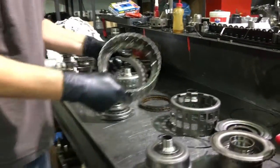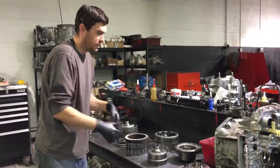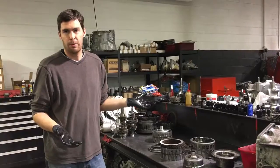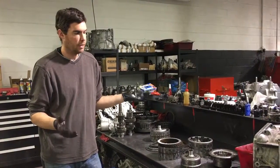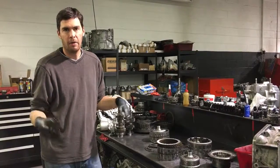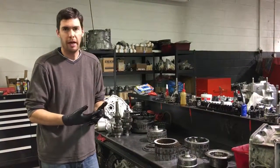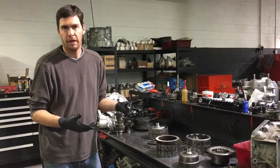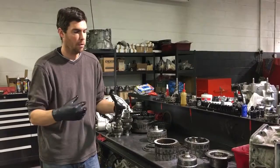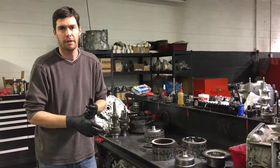So that's about it. There's the carrier — you see it's divided in the middle. That's a very basic explanation as to how this clutch system works. Basically all the clutch is doing is transferring the engine power to the gear set in a smooth manner. The less pressure you have, the more slip it's going to have and the smoother the engagement. The more pressure you have, the more everything is going to generate friction and the more torque it will transfer to the gear set.